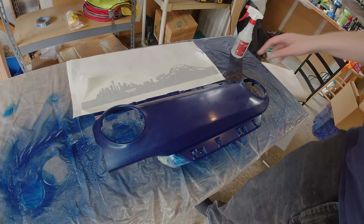Just a few drops will do it, helping break up the surface tension without interfering with the adhesives. But with my overly soapy mixture, it completely ruined the vinyl and it would not stick at all. Getting vinyl decals cut at a local shop can cost quite a bit due to minimums, so I decided investing in a home vinyl cutter would be almost as cost-effective — and I have future plans for it too. To apply the decal correctly: remove the paper backing, wet both the decal and the surface, apply and reposition as needed, then squeegee out the water from underneath so the vinyl can adhere.